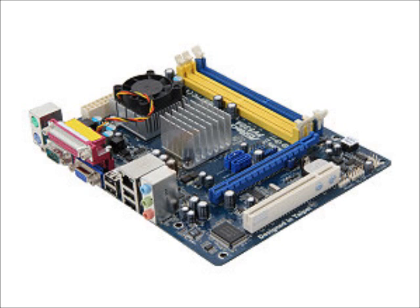The RAM I've chosen is 1333 megahertz — spoiler — so it'll throttle down. But if you build a new PC in the future and you want to reuse that RAM, it'll still have that speed. It just throttles from the processor's ability to use that much RAM. Also, if you have some DDR2 RAM, feel free to reuse that. The board has LAN, USB 2, PS2 ports, all that good stuff. It's a micro ATX, and it's from ASRock — ASRock is awesome.